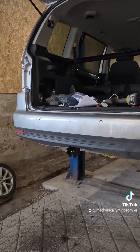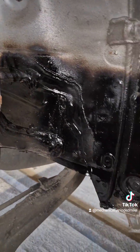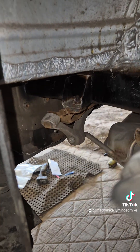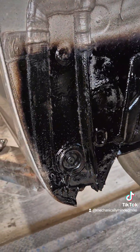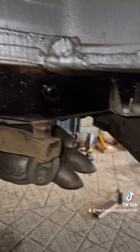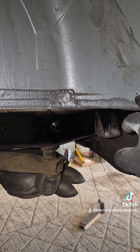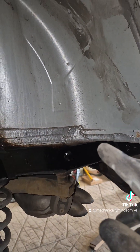So that's the bar mounted. The customer went for a swan neck. When I was in here, I spotted a few rust spots, so I just brushed them down and applied a bit of wax oil while we were in here — makes sense. There's an exhaust hanger bracket — not going to bother spraying that. Same over here, a couple of rust spots. All the new area has been cleaned out. It just mounts in, slots in to where the old one came out. They give you instructions — I think it was 75 newton meters — and that's all done.